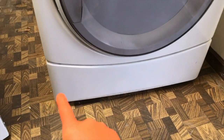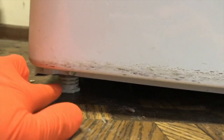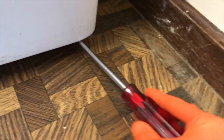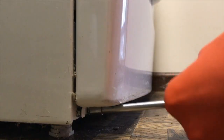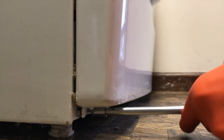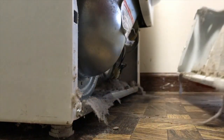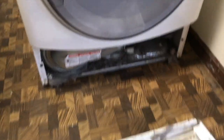On the front of the dryer we are going to remove this access panel. Come down below — on the bottom of each side you've got two little screws. Go ahead and remove the far right screw as well as the far left screw. After removing both of those screws, go ahead and carefully shift this cover plate off and you've got access to a lot of parts.